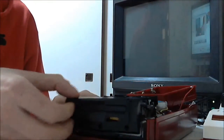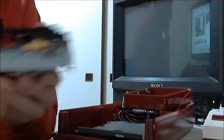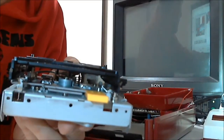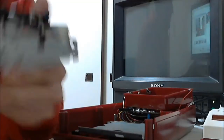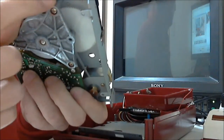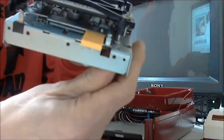As you can see, nothing's loading, so we can now correctly align the spindle piece without any need for fine-tuning for badly written discs. Using your thumb, rotate the large plastic cog underneath, clockwise, until the flat end of the spindle piece is facing towards you, so you can see the tiny socket screw.